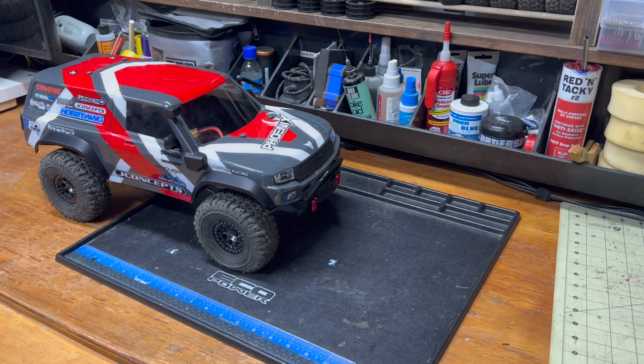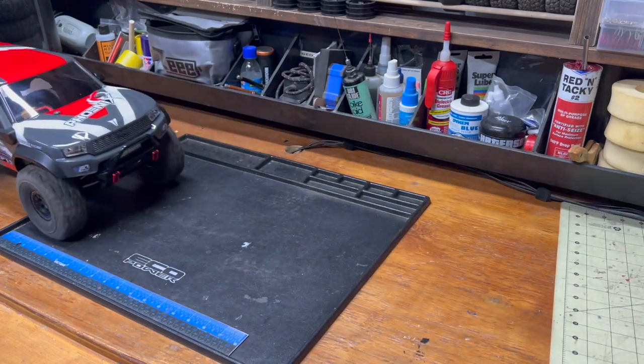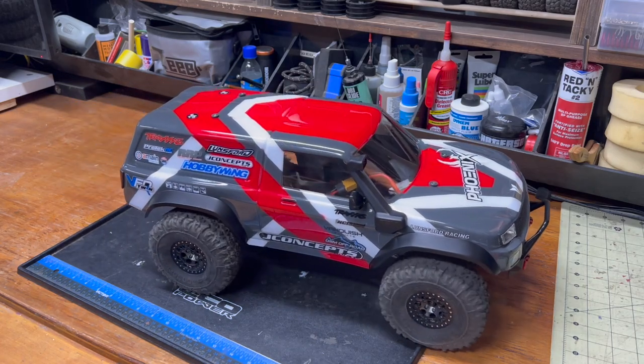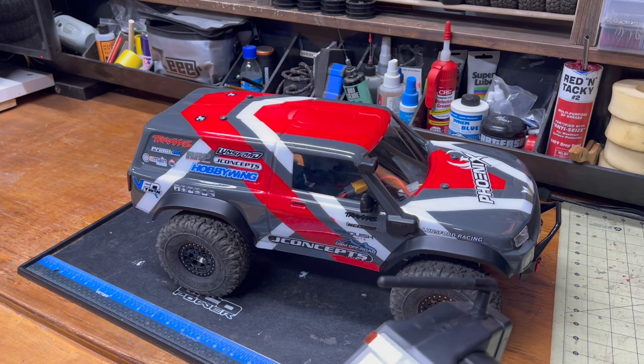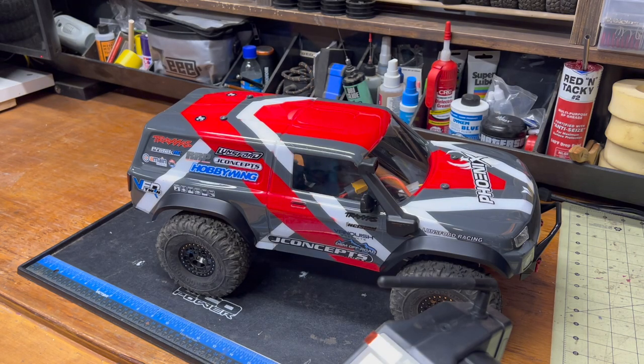With that much low-speed control, it's also got some zoot and zap as well. I've got my old-school spreadsheet here so I can mark down what parameters I've changed. Out of the 13 selectable parameters, we will be trying RPM matching mode and normal mode so we can fiddle with the RPM decrease rate in parameter 11.